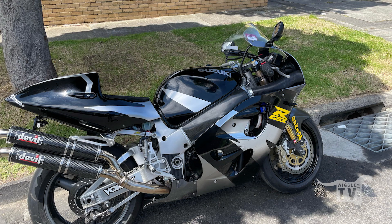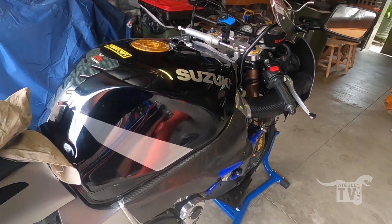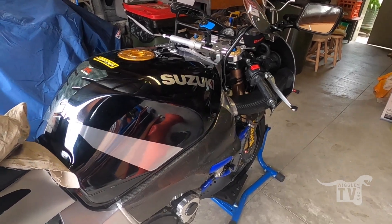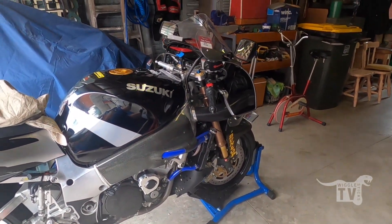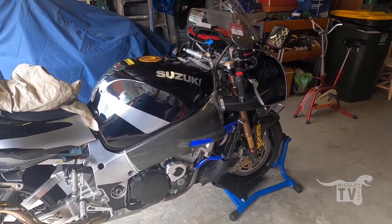I had a few issues when I rode it last time when it gets really hot. The fan and everything is kicking in but the bike sort of feels like it wants to conk out when it's between 100 and 110 degrees centigrade, roughly when the fan comes on at about 107. When I brought it back it was just running really really rough and sort of felt like there wasn't enough spark.